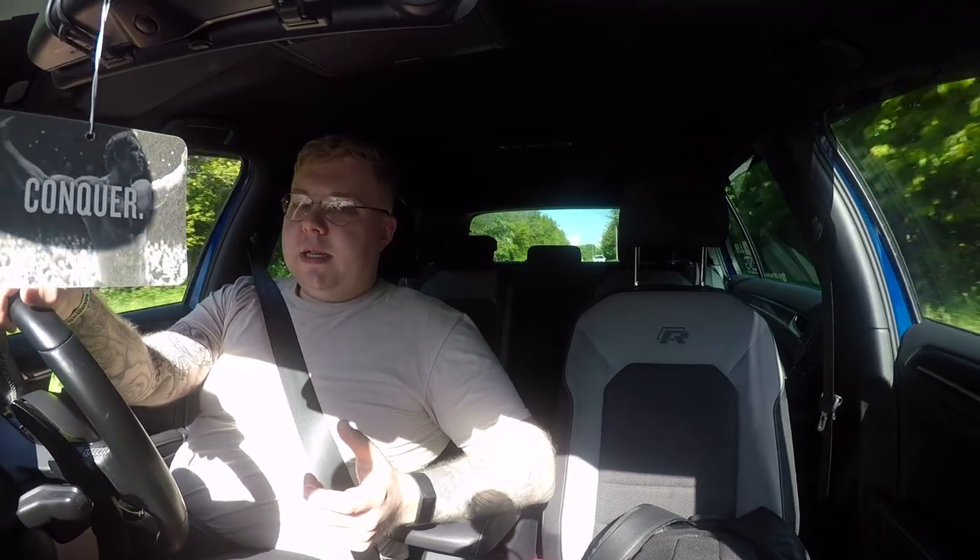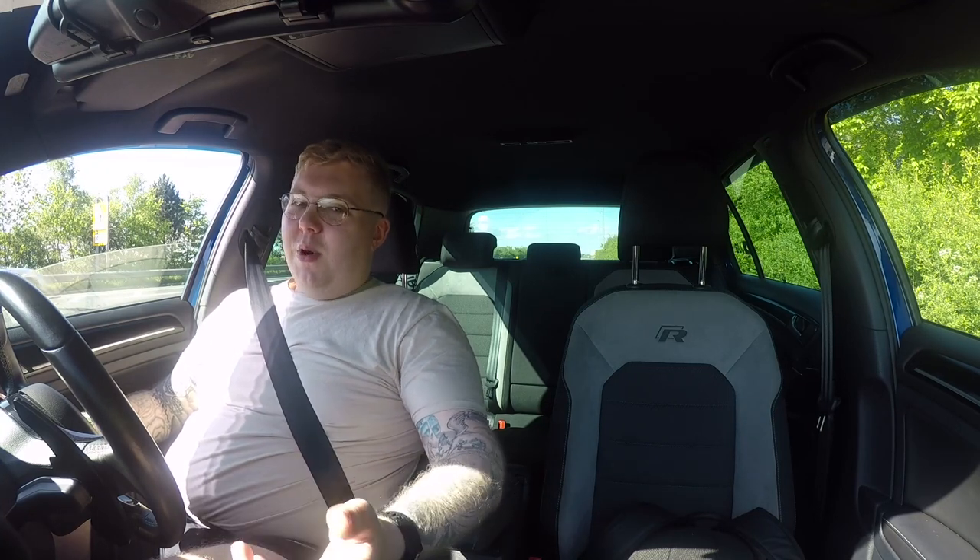Going into sport mode, getting set up. Just can't seem to get higher - 4.37 seconds, which isn't great. I might have to do some logs for Shaq because it's not performing how it should. I'm going to pull over and check the JB4 settings. On the main display it shows RPM, boost, ignition, AFR, intake temperatures, and what map you're on. The intake temperatures are at 102 degrees, which I think is ridiculously high. Does that warrant an intercooler? Probably. Does an intercooler warrant stage 2? Probably.